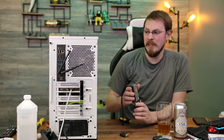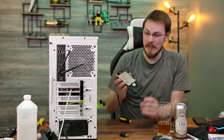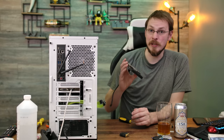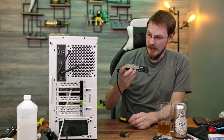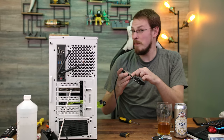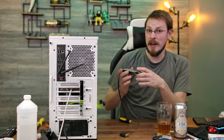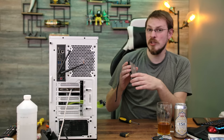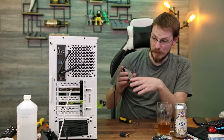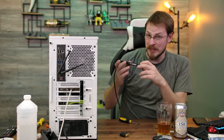From what I can tell, nothing is actually shorting out or grounding out when I put this heatsink on. I think I have plenty of clearance from all the components. I did double check all that. I am getting good die contact. I think the problem is either that capacitor is being bent a little bit too much, or the crystal oscillator that I relocated, I either damaged in the process or possibly just didn't get a good solder job on. But from what I can tell, the solder is bang on. My bet is on the capacitor.